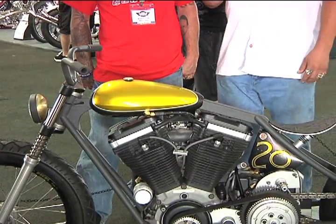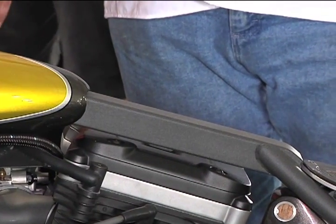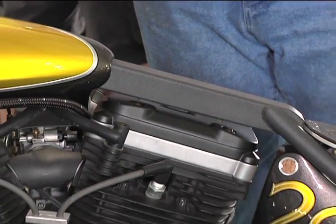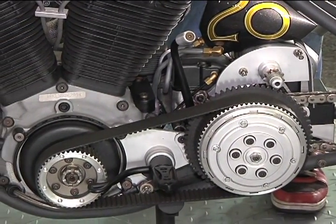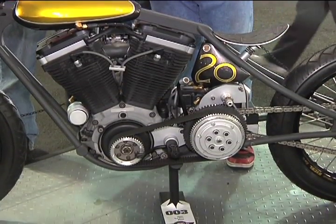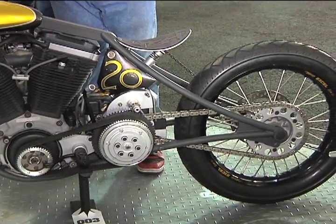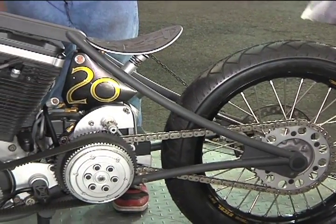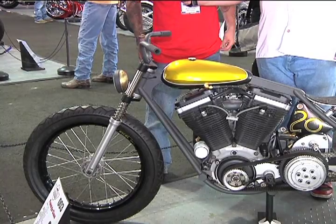So let's talk about that square backbone tank frame. Where did that come from and what did it take to put that together? The frame was actually the biggest challenge. It looks so easy and so minimalistic but there were a lot of challenges. The transmission is an inch and three-quarters up and an inch and a half forward, so it gives it a shorter, tighter look. I had to make my own belt drive system and find a belt that would work with those pulleys at that distance. The chassis has a very unique stance — nine inches of ground clearance. On the bottom of the frame there's not one piece of the motorcycle that sticks out. It's got a 26.5 degree rake with 4.5 trail, and the same axle distance as the CRF 450, which is one of the best motocross bikes in the world. Starting with that platform and working from there was a great challenge.